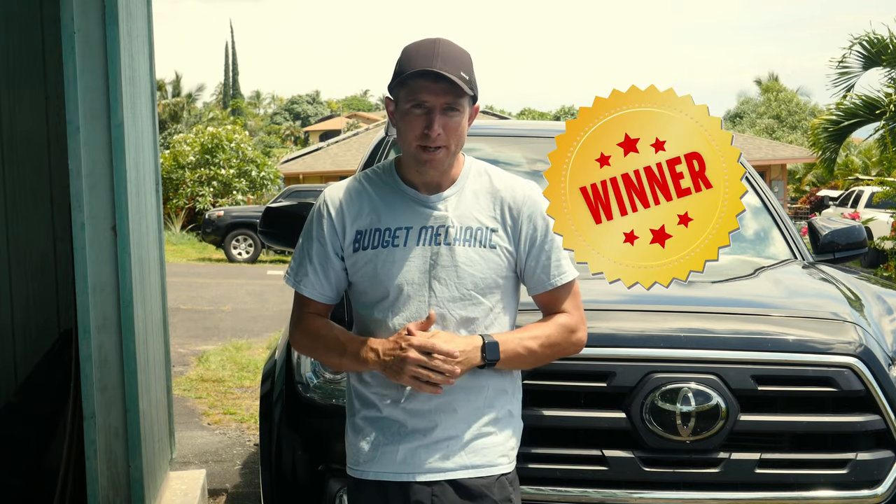So what does this mean for budget mechanics? For the majority of drivers, you're going to get the most bang for your buck out of a ceramic brake pad. Even though it's more expensive upfront, it's the most cost-effective overall — you'll replace your brake pads less often, wear out your brake rotors more slowly, and replace them less often. It just saves you money in the long run. Plus, with a high-quality ceramic pad, you get the benefits of low noise and low dust.